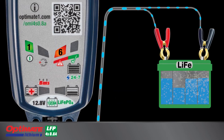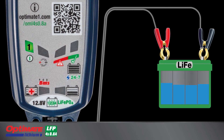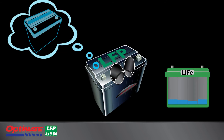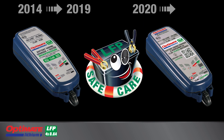Lamp 6 blinks if, during the save mode, the charger detected a fault within the battery; or it could not hold sufficient charge during the final test; or current draw from the vehicle is higher than the charger can deliver. Beware — a lithium battery that is frequently deep discharged will suffer permanent damage. Use this Optimate lithium to keep your battery healthy and charged when the vehicle is stored.